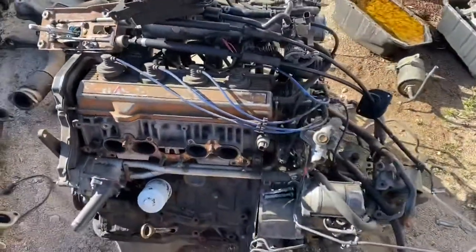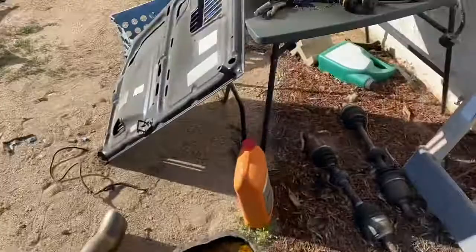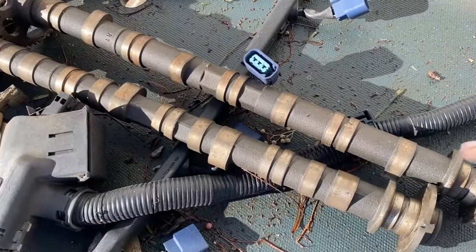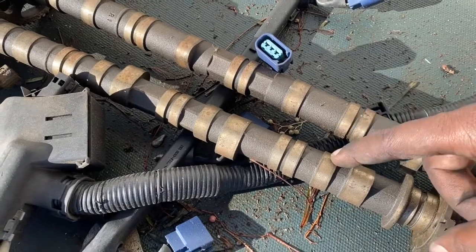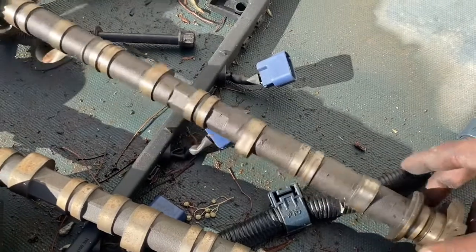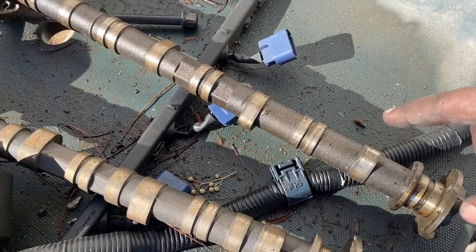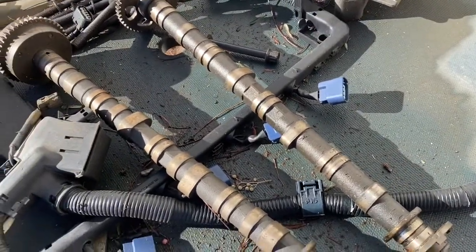I also still have this motor available if anybody's interested — Corolla, Camry, or MR2 five-speed swap, still good. Here are the economical cams — this is the intake side; it runs on this slope first and then when VTEC hits it runs the second valve. This is the exhaust — as you can see just one lobe runs both rockers. When doing a VTEC killer system, this is the rocker arm assembly on the exhaust side — you want to get that to run on both sides using the Type S cam if you want to do a VTEC killer setup.